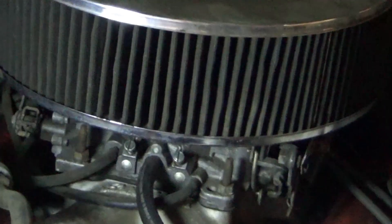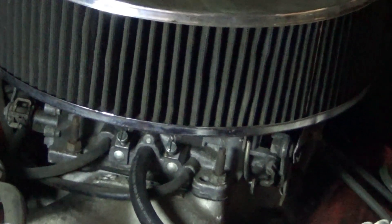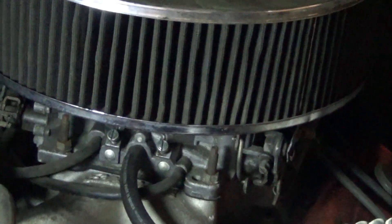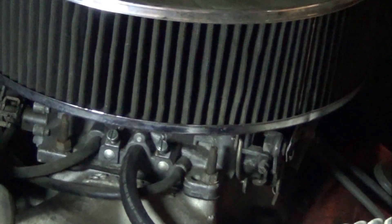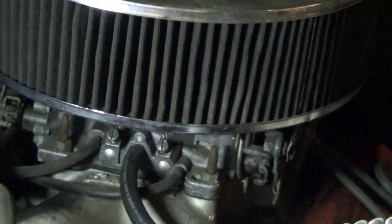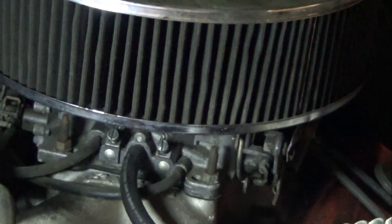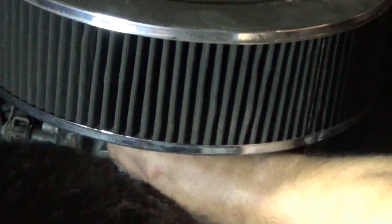That's the reason I keep saying you need to do everything else first and this needs to be last, because everything else needs to be worked out — maybe timing issues, maybe vacuum leaks, all kinds of stuff. I can already tell it's a little bit rich because the exhaust smells like fuel. It was hanging out around 12.6 to 12.8, so what that means is you need to lean it out a little bit. But I didn't even really need the wideband for that — I could have done this without it. I'm just going to do a quarter turn in on both idle screws.